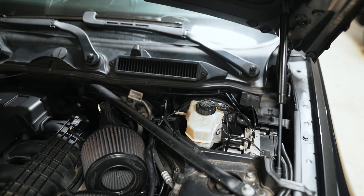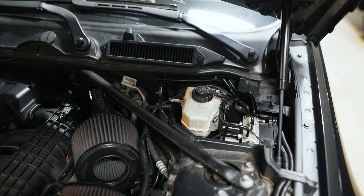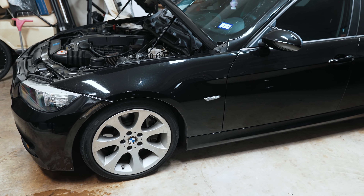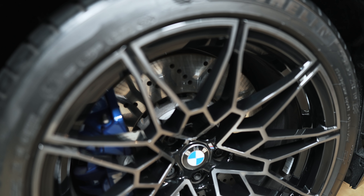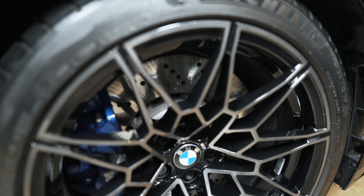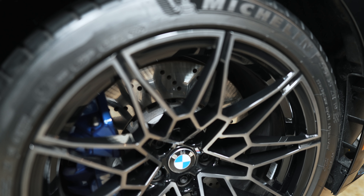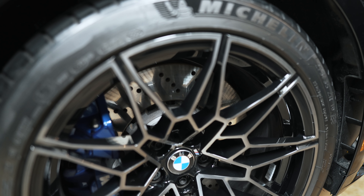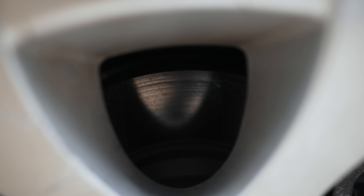There's pretty much only one scenario where I've overwhelmed these brakes: after a few hard haul-downs over 100 miles an hour, typically done at the drag strip. The amount of heat you can generate in these brakes when the car has double the horsepower is an issue. On an M car you can expect drilled rotors from the factory. The reason you'd want drilled rotors is because the pad, when it gets hot enough, will off-gas and create a layer of gas between the pad and rotor — you need somewhere for that to be relieved to maintain surface area. Unless I upgrade my pads and rotors I won't completely solve the issue, but I can go a long way to helping the cause.